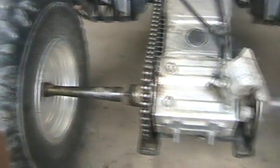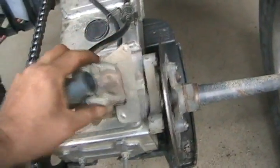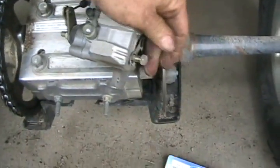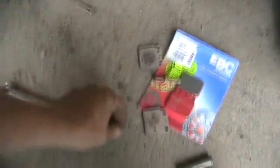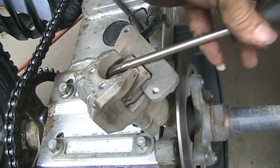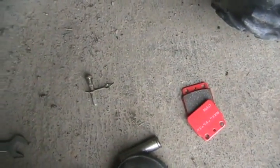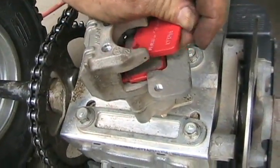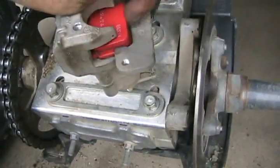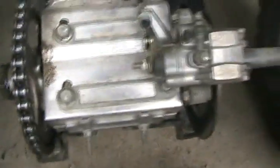The axle job is done - all bearings and seals replaced and everything put together. It was not even a two beer job. Now for the brakes: bend over the little locking tabs on the retainer pins, unscrew those, and they jump right out. Set both old pads laying there, stick a flat screwdriver in the gap, rotate it - that works like a clamp and pushes the piston all the way back to make room for the bigger thicker new pads. Drop one in, set one in, put the retainer bolts back in, and you don't have to fully tighten them until the whole caliper's bolted on. It's only a 10-minute job.